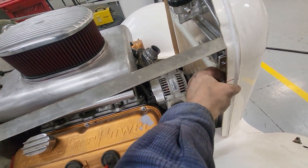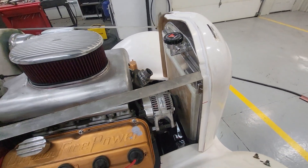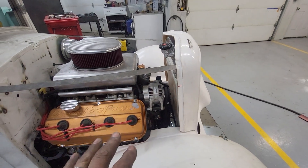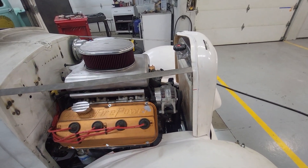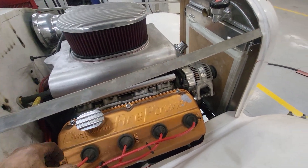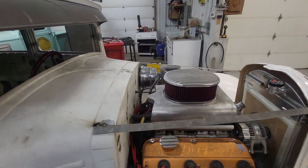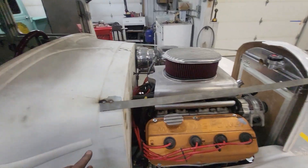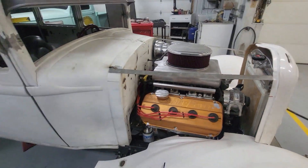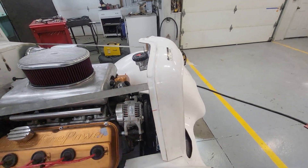I'll make a bolt-in bar with a carriage bolt in here — it'll hide the heads of the carriage bolt. I was looking at something I could carry my hood sides down to, with a bend so they just set in there. I'm not going to run my hood sides up that high — I'll run the hood down and bead-roll across there. That bead will probably just die somewhere in the hood to a point.